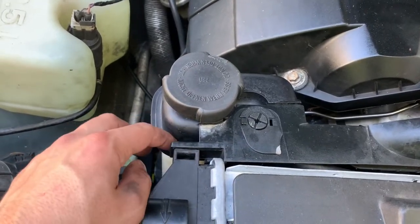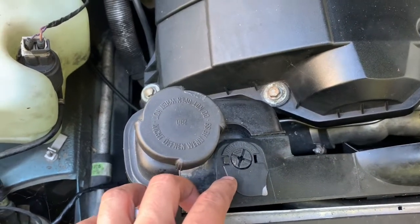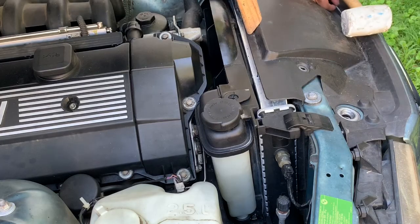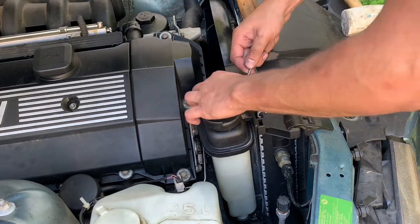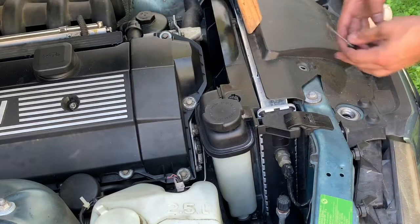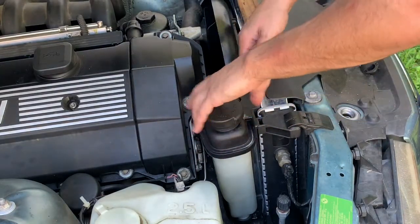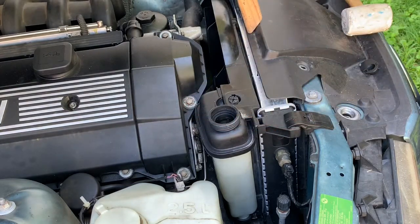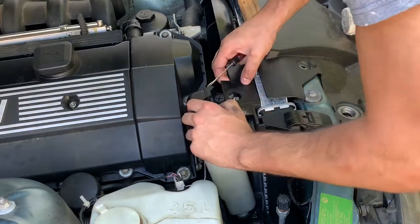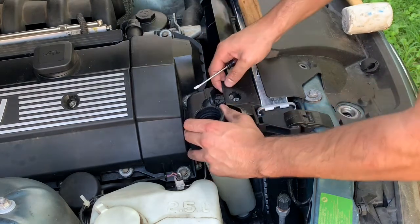On the plastic weld underneath here, you've got this screw right here and this plastic tab — one of them is broken right here. Just pull this off with a screwdriver. This vehicle is already low on coolant so I don't really have to drain it, but if you want to, you can drain the radiator first — that'll reduce the coolant spillage. Pull the reservoir out.